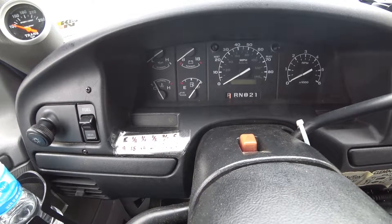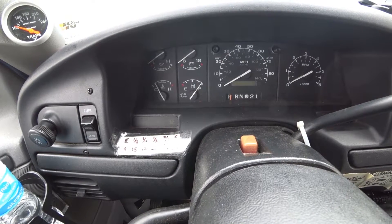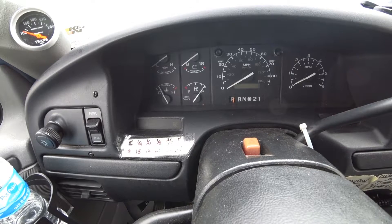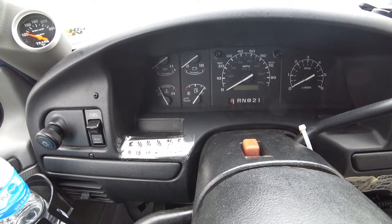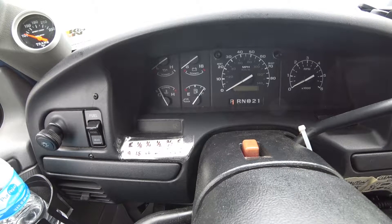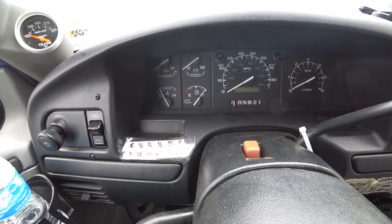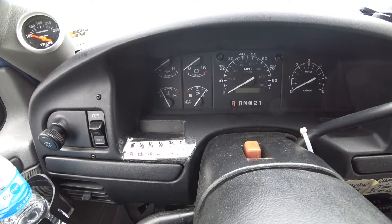I took the truck to the auto parts store and had them run a test. It came back good — it said my battery was getting old, which I knew — but the gauge reading was never an issue with the same battery and the old 95 amp alternator. What I figured out was that the voltage was being regulated differently. It wasn't a pulley issue or an RPM issue. I needed to get a regulator that was correct for this vehicle and the load it required running a 130 amp alternator.